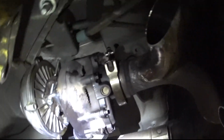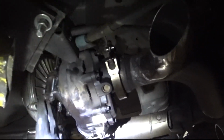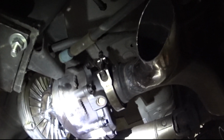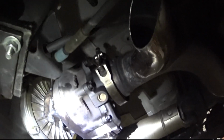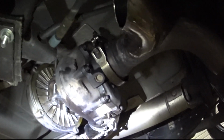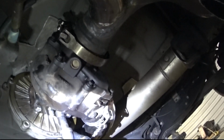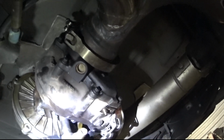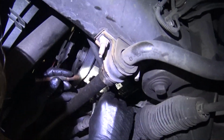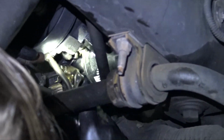For those of you tuning in, yes, that fitting is crooked, but that's the direction the actual hole went. So instead of drilling up into the housing all crooked, I just drilled through and then tapped it that way. So we're catching some decent threads now that I got it all tapped. Hopefully that should seal up nice, and hopefully it doesn't leak. Yeah, it was hitting the housing. So David's over here trying to get this damn fitting straight. It's gonna be a pain in the ass. Trying to get it tightened.